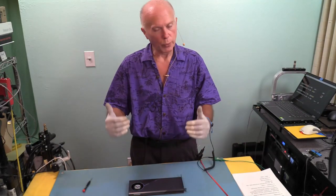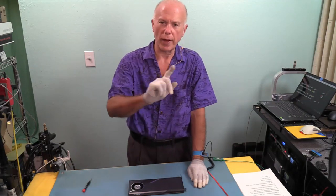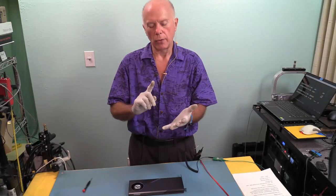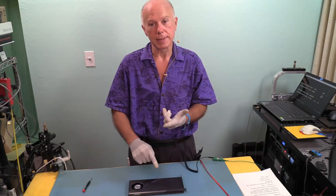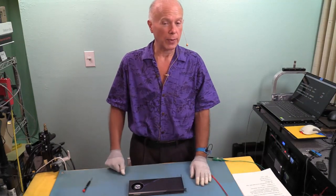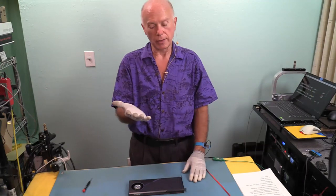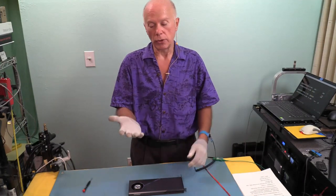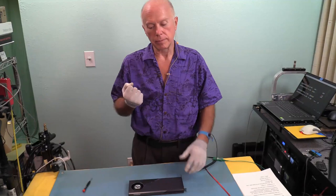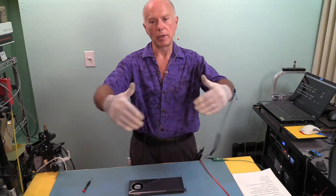You can put, and we suggest, all four drives be the same. That's what the manufacturers say. But you got to remember, when RAID started, RAID was about redundant array of independent disks. And it was for spinning drives, and it was on SCSI. And that's how we came up with hot plug, hot swap. That was originally that if you had RAID, where you had it configured, where you had it striped and mirrored, you could take one drive, pull it out, the RAID did not come down. You could put another drive in, it would rebuild, and it would keep going.